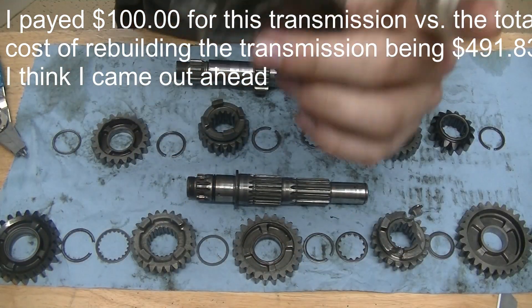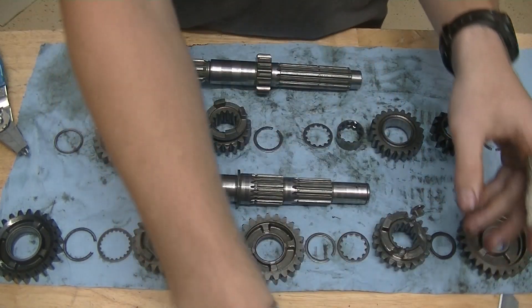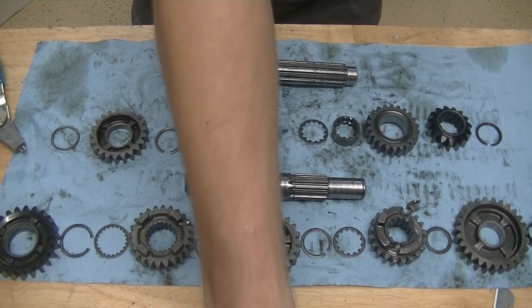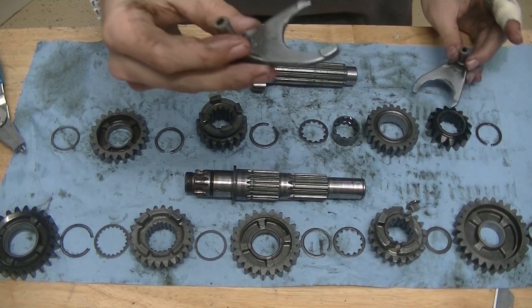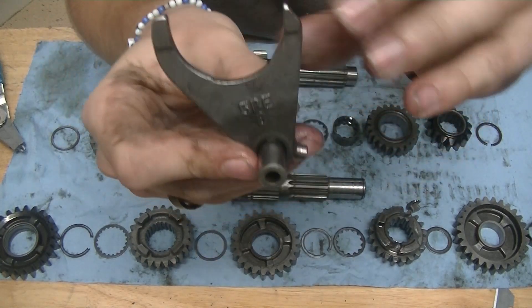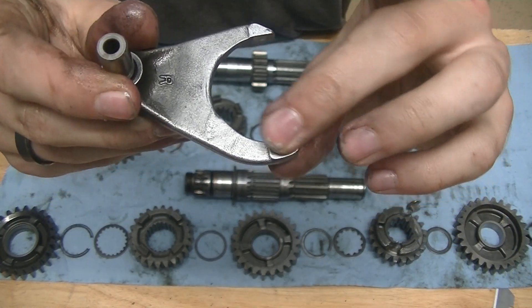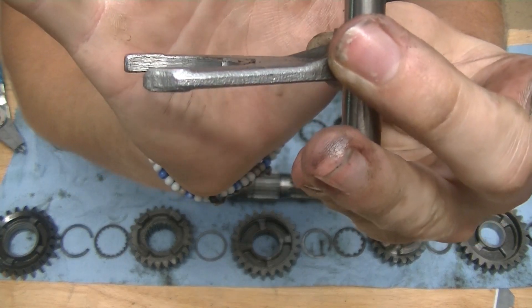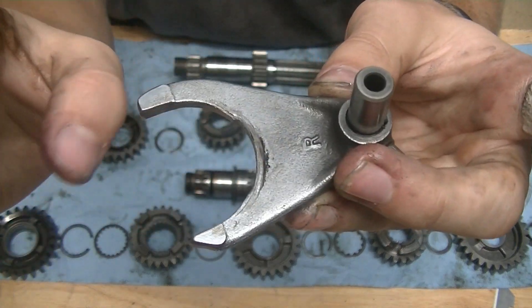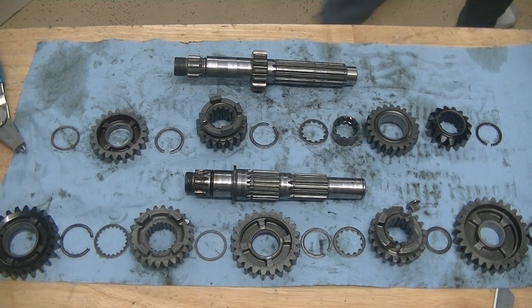Included with it, I got all of the shifting components — these forks and the shift drum. If we compare to my old transmission, this is the same gear both labeled R for right with the 5BE. The only thing you have to look for on these is this surface on both sides — make sure it's not cut. You can run your finger on it. And then on this one you can see that nice layer of metal kicked up right there, very sharp — you can see that big wear scar there, and a little bit of scarring there. That's the only one that's damaged on my old transmission. But that's what you're looking for.